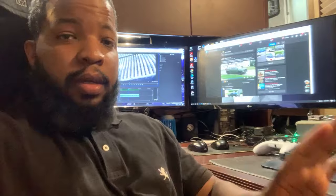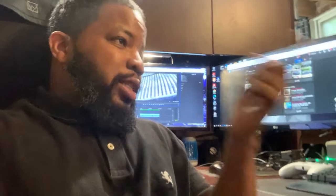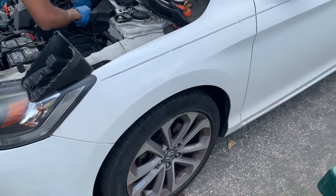My friend's Honda Accord is having issues starting. One day it just wouldn't start - but when it does start, there's no hesitation. It starts normally and just shuts off. So it's not spark, it's not fuel - it's something electrical, or maybe air. It's definitely getting fuel and sparking because when it starts up it's not hesitating, but then it just cuts off.